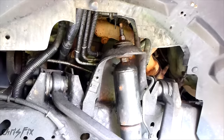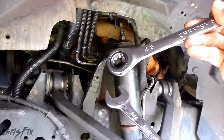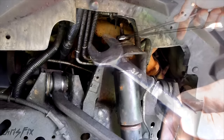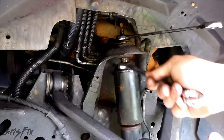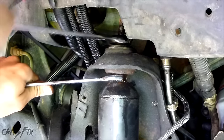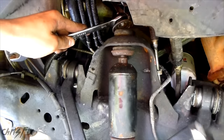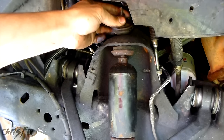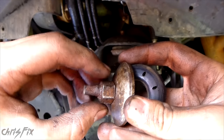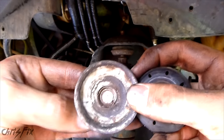We'll start at the top here. You're going to need two open-ended wrenches — I actually have a ratcheting one. This is a 5/8ths, and that's going to go on top to make my life a lot easier. I'm going to use this 3/4 to hold the nut down here. I switched over to a 15 millimeter — it fit better than the 5/8ths. It looks like I snapped the top nut. You can see there's some bulging rust right here, which prevented the nut from unscrewing, which caused a lot of pressure and snapped it right off.